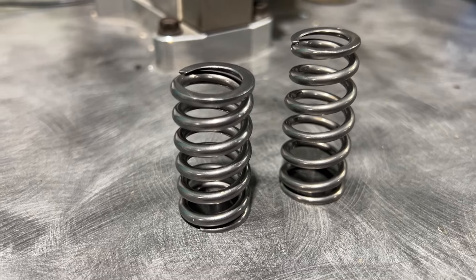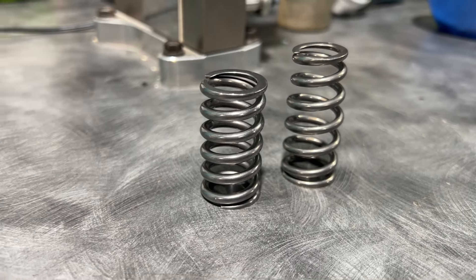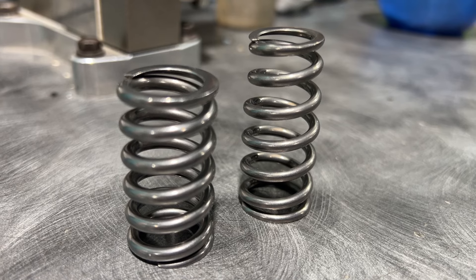It's easy to see just looking at it that they are two different shapes. You have a cylindrical spring on the left — that's the HeadGames spring — and a conical spring on the right, that is the SuperTek. In all actuality they're both SuperTek springs, but one is ours. Our single cylindrical spring from HeadGames just had a lot more cushion for the pushing. When we started doing S55 heads, we had to come up with a spring kit because nothing was available. I approached SuperTek, we found a spring and had to get a retainer made — and it was made for 1,000 horsepower plus because that is our customer. When you get into 800 horsepower and above, it takes a decent amount of spring pressure to keep the whole valve train happy.